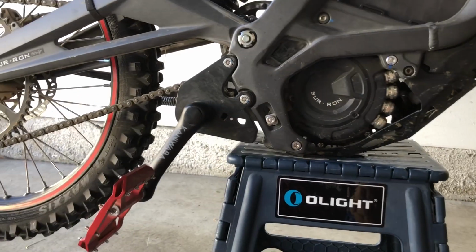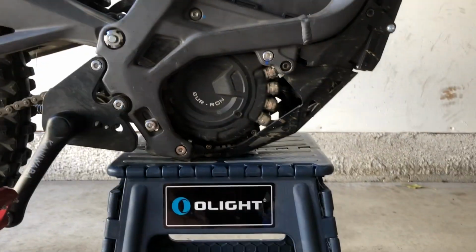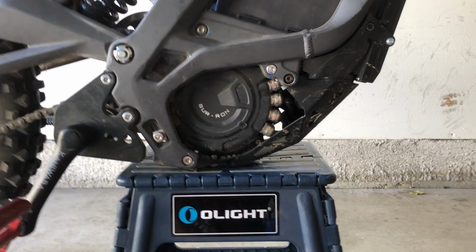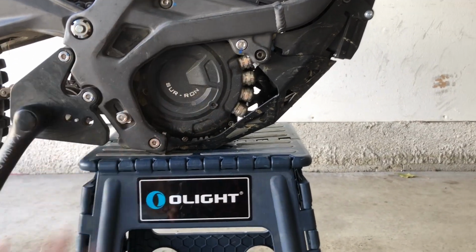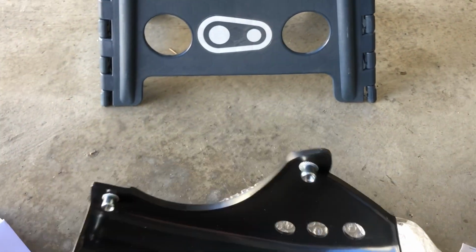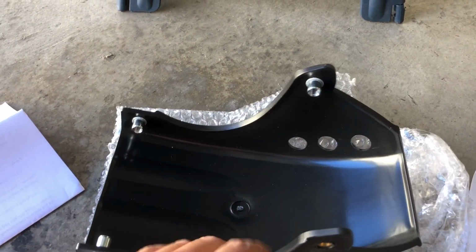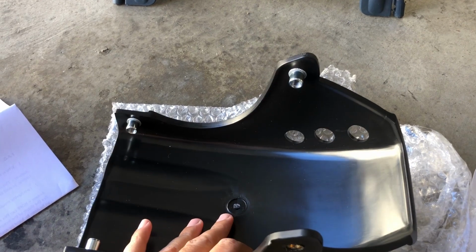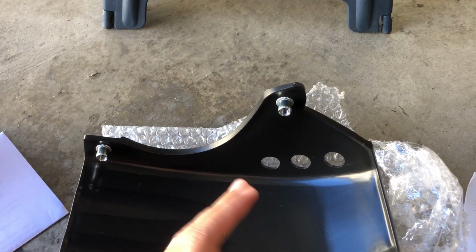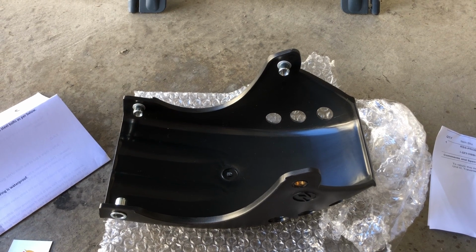So there are those two schools of thought. If you have a full stainless steel or steel bash, a lot of that force and trauma is going to be transferred into this aluminum right here. Having something like this HDPE polymer material, it's going to have some flex and definitely some shock absorption properties. So that's why I went with this one in particular, along with the whole weight issue. And to my surprise, I expected to wait a month for it to come, but it came in about a week.